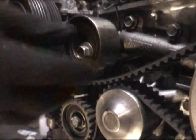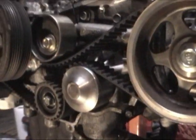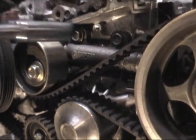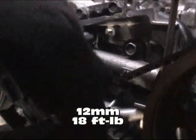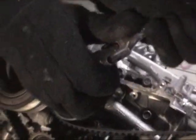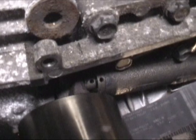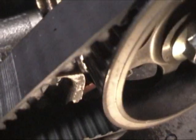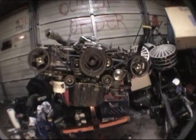Turn all the slack out of our belts, make sure they're all tight. If we want maximum tension on our log we can try to wedge it over and get some behind it, because those are slotted holes. If we kind of push it over here first and tighten it down, it takes the slack out of that piston. That piston is actually going to act like a suspension for the belt — as it lashes every time the cams rotate, it'll act as a shock absorber. So here we go — I'm going to pull the pin. I pushed this log forward before tightening it down so that piston doesn't hyper-extend and lose tension. Look at that — that timing belt is on!